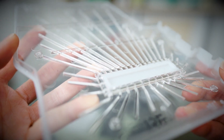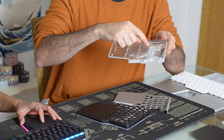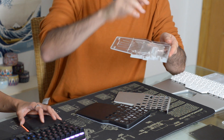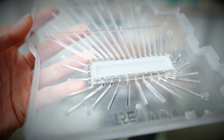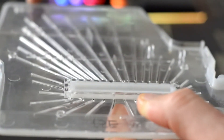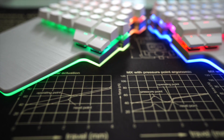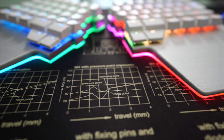The base is a totally different piece. This is injection — double injection — and two different plastics. The first plastic is ABS, acrylonitrile butadiene styrene. And the other plastic is polycarbonate. We have these small canals — like light pipes — that receive all the light from the PCB. The light hits a 40-degree mirror on the side, so the light coming in one direction is distributed across 160 degrees to the diffuser around it. It's all calculated so the light is even and has the same intensity across the entire perimeter.